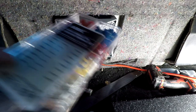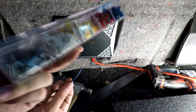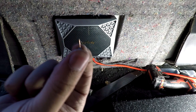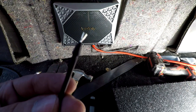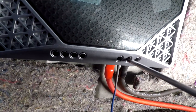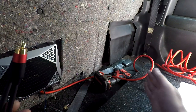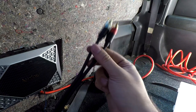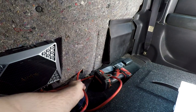For the remote wire, I'm going to be using a reusable ferrule set. If you're into car audio and don't have a set of these, I'd recommend buying them — they make cables reusable without having to strip them apart consistently. Just put one on and heat shrink it so it stays in place. With the remote wire in place, route it down the same path as the power wire. You can run the RCAs down the same path, but I like to run them down the opposite side to avoid any noise interference. Route it behind the insulation, making sure the wires are not too visible.